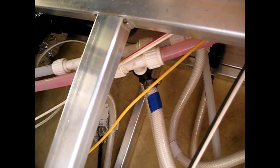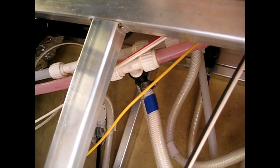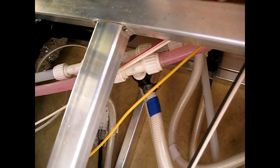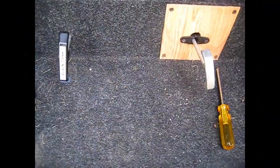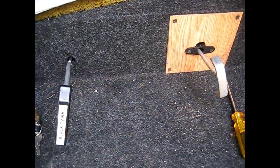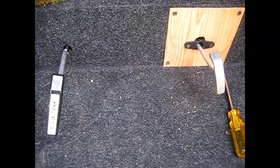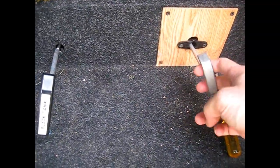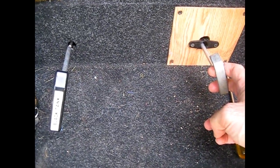Step 2 is you want to drain all your tanks. You want to drain your fresh water tank, your gray, and your sewage. When you drain the tanks, you want to make sure that you do the black water first, and then after the black water has drained, you do the gray water so that the gray water flushes out the rest of the black water — the sewage.